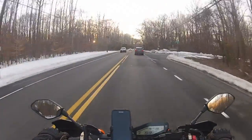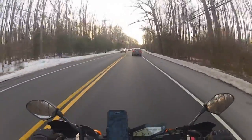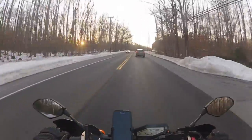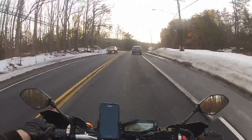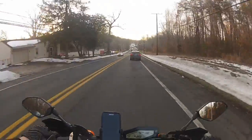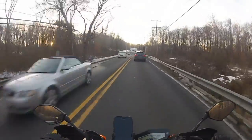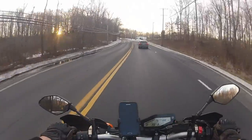I'm so used to kinda tensing up or gritting my teeth over some of these bumps and they're sure as hell not as smooth as a cruiser, but it feels much better. I did bump up the preload a little bit so I'm currently running with 32 millimeters of preload, and that feels pretty good right now. I haven't gotten any twisties to really feel it, see how it does in corners, but just cruising down the road it doesn't feel too bad.